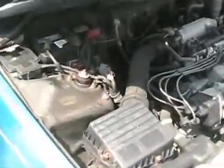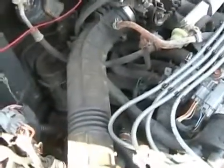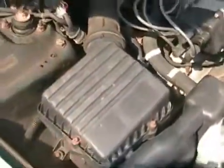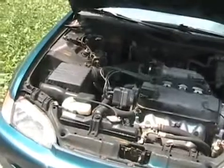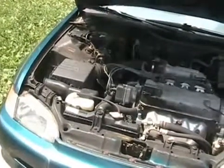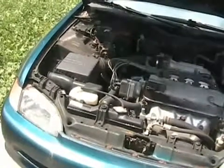Well, as you notice, the intake snorkel has a few ribs on it because your motor flexes back and forth. And it's not the largest diameter it could be. And of course there's room where you could actually make it longer. Well, the theory behind adding one of those fancy chrome tubes is, yes, it does increase performance a little bit, only noticeable under high RPMs.